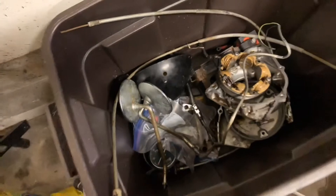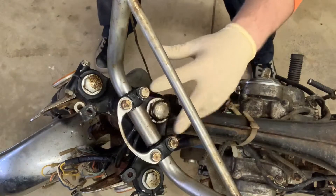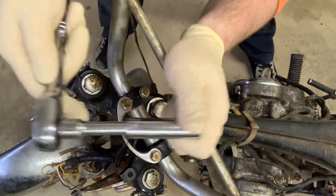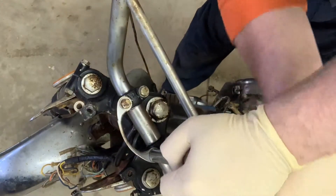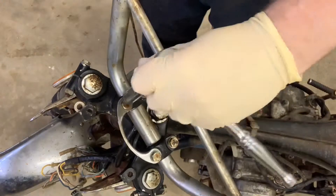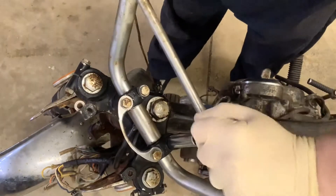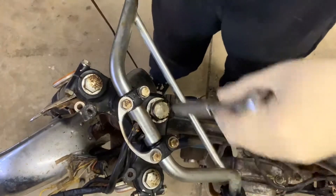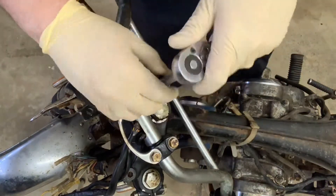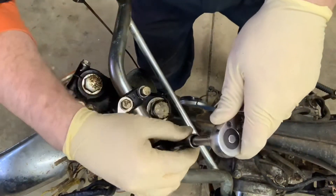Regardless of the condition, we're still going to put them in the box, because you never know. To take off these handlebars, it's really just these four bolts that we've got to take out. What you're going to need is a 12-millimeter ratchet. Set it to extraction mode and start working on these. These should come free pretty easily. You can see the handlebars are already loosening up — I can move those right out of the way. A lot of times you're able to just get them started and they come out really quick.